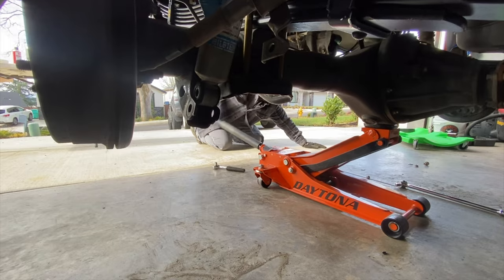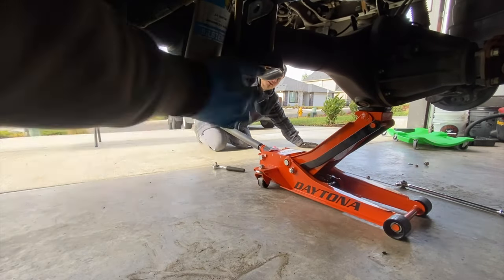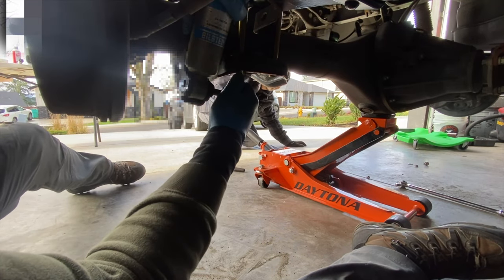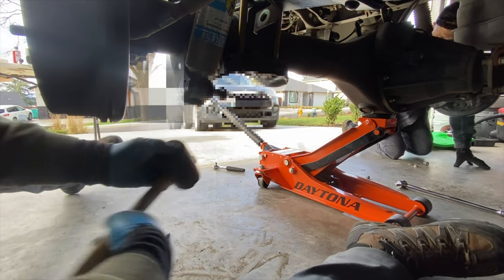And next step, I'm gonna go ahead and land my rear shock absorber and cradle that into that pocket ever so perfectly. And I'm gonna slide my bolt, and I'm gonna torque that bottom bolt to 43 pounds, and the top bolt should be torqued at 15 pounds.